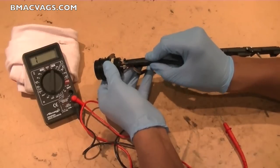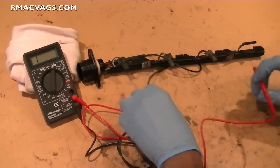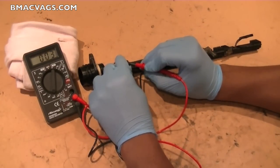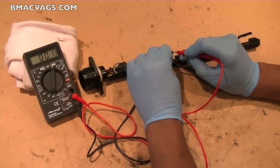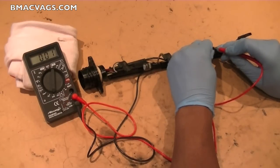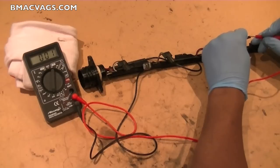We'll do the same thing and probe the brown wire. The brown feeds all the way through so we need to get a reading. It's two ohms — virtually no resistance, which is good. Less resistance means a better connection. You do this through all of them. What you're looking for is nothing extreme — if one jumped up to eight, nine, or ten ohms, that's where you've got a problem. But if they're all around the same, you're more than likely okay with this loom.